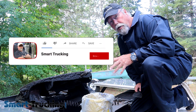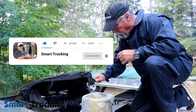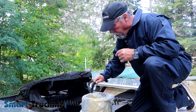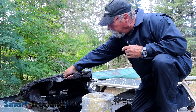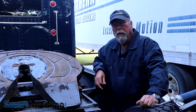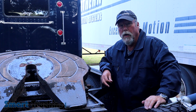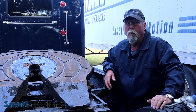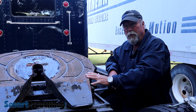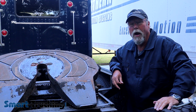In this video, I'll show you how to grease and maintain the fifth wheel. Step one: clean all the old grease off the fifth wheel, because you don't want the old grease contaminating the new stuff you're going to put on. You get grease on the front of the fifth wheel for a certain reason, which I'll demonstrate in a minute. I've left my fifth wheel go dry particularly for this demonstration — this is how the fifth wheel should not look, and this is why you're going to keep grease on it. Any bare spots at all are not good.